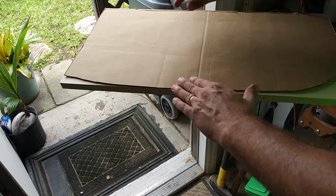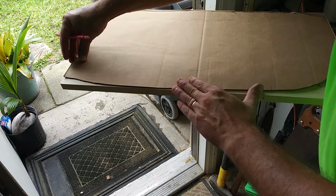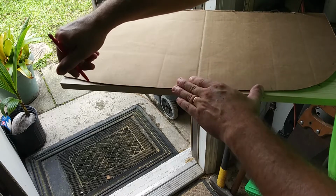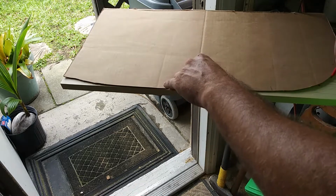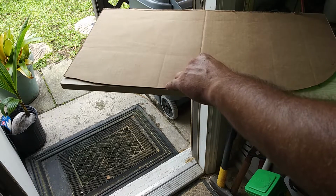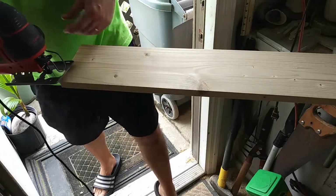So we could get the mattress to fit in the recessed areas as far back as possible and have enough head and foot room in the bumped out areas, we had to get creative with framing it out. We couldn't just cut straight pieces to form a framing box. We had to cut and sand each piece to fit perfectly with the curves of the van.